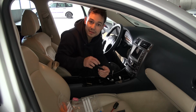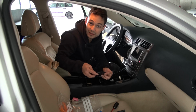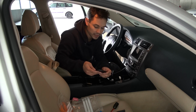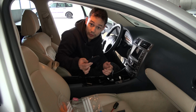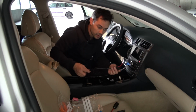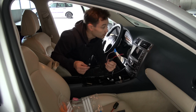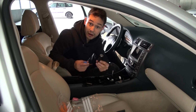But actually that's not the case, because it's not exactly 12 volts that the car generates, it's always a little bit more from the alternator and so on. So I connected everything, and I realized that the light doesn't turn on on the wireless charger. I realized that this cable set, what I made the first time, is actually also USB and also has a fuse over there. That won't work, and I have to purchase a cigarette lighter plug.